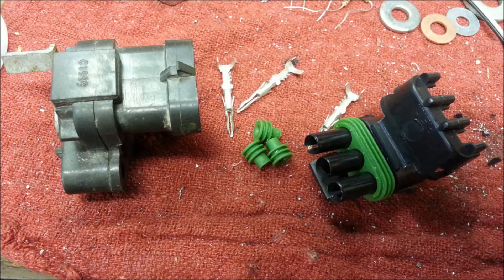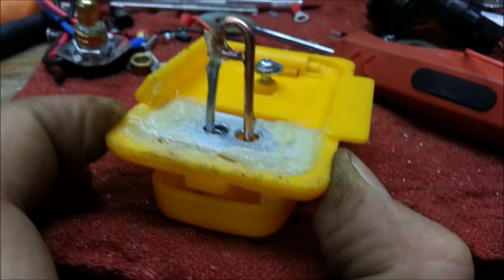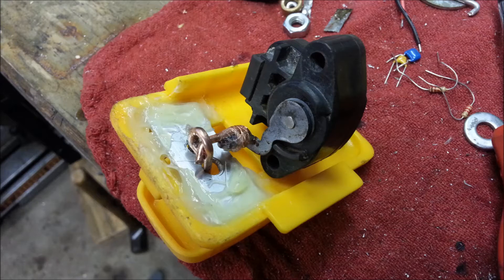Moving on to the variable throttle, we're going to start with a 90s GM throttle position sensor and mate that with a nice Delphi weather pack connector. We wanted to retain the stock look of the throttle pedal, so we made some mounts using plastic epoxy, aluminum, and some metal TIG welding rod. I attached a little extension to the throttle position sensor using that rod, then bound it with a thinner gauge copper wire and filled it all with epoxy. We'll see how this works out in this video.